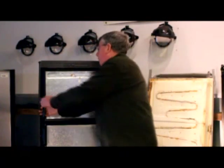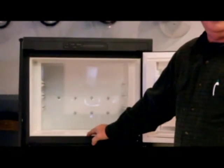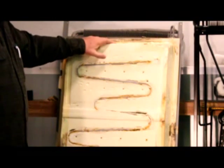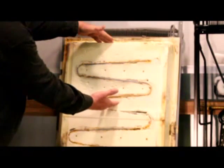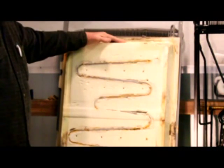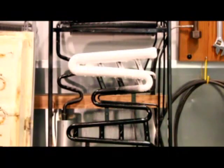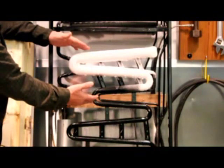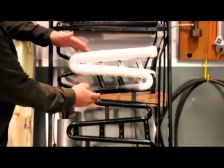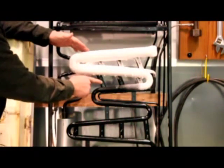This is the freezer section that you're used to seeing. The lower temp part of the evaporator is what cools this freezer compartment. This evaporator is surrounded in urethane, insulating the evaporator. Here is the low temperature part of the evaporator, which feeds the freezer compartment — you can see it's doing very well. Here are the holes that actually bolt up to the back side of the freezer compartment.